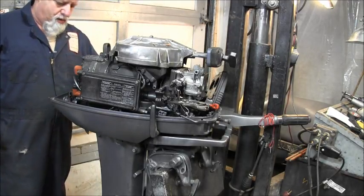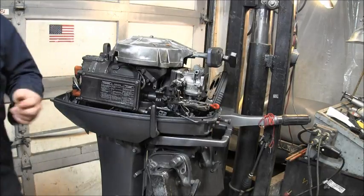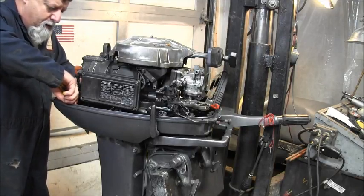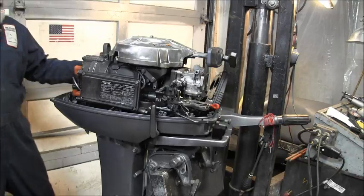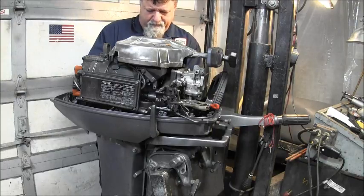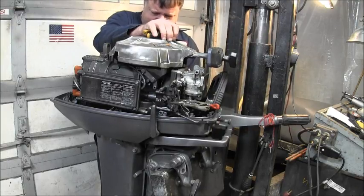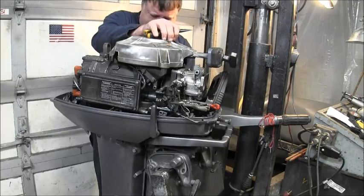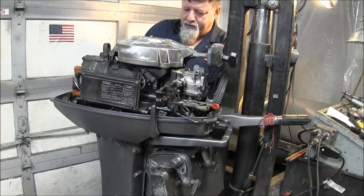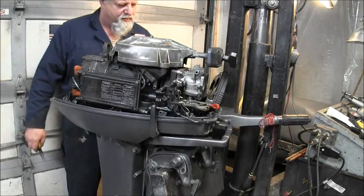The overboard discharge. Stick it right back there where it's supposed to go. But my big old fat feelers, so I have to get the needle nose, put that on. Okay, on this side over here, you can't see it, but all I'm doing is hooking up this fuel hose to the fuel filter. That should be pretty straightforward. Then I got one of these little cheesy wire clamps, but there that is. Okay, that's the only thing that goes there, really.